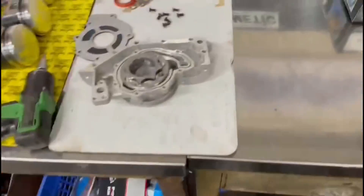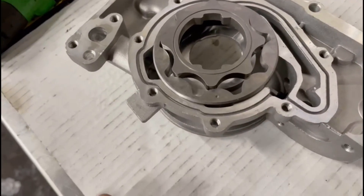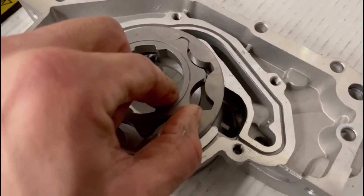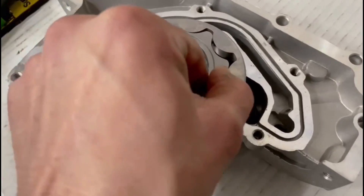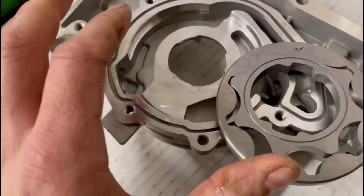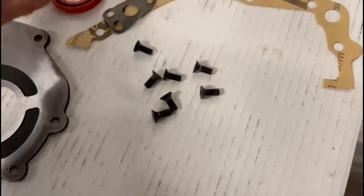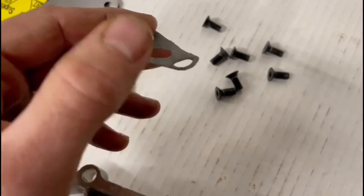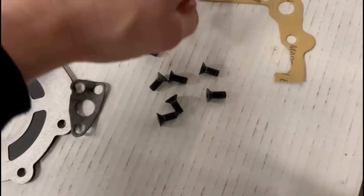We've got a new oil pump which I've decided to strip and take the cover off. I've had new oil pumps before where they've had debris or swarf in them, so I thought I'd just take this apart and double check. It's a fairly simple setup - just two gears sitting inside each other. I'll put a bit of oil in here as well so when we start the engine it's not dry. We've got the seals and gaskets: the main seal, the gasket connecting the oil pump to the pickup, and the oil pump to block seal.